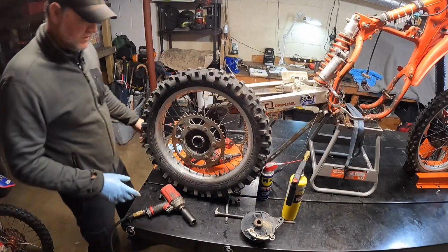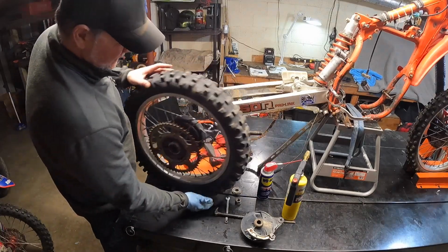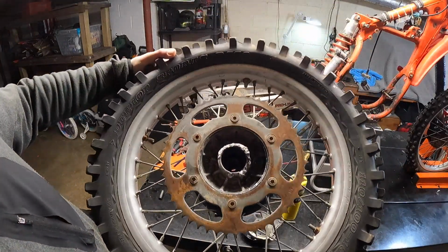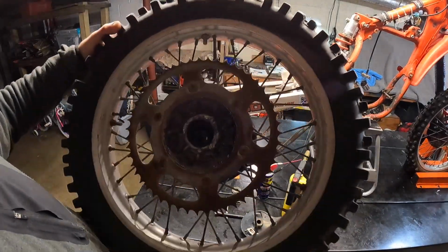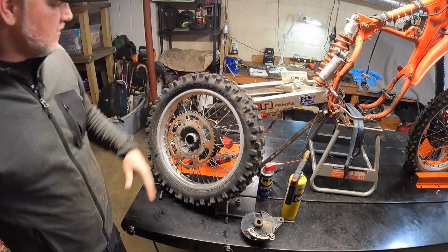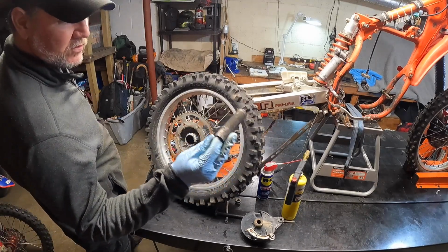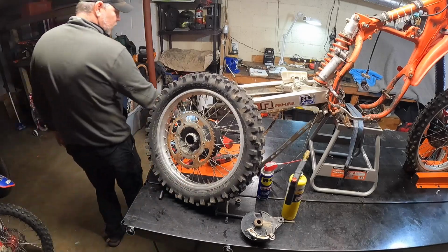So you guys saw how to use heat on that axle and everything, but here's the reason: the whole entire bearing just fell out. I don't know if you can see that, but somebody tried to aluminum weld this rear rim. Somebody messed that up pretty bad. So like I said, that's why I had ordered another one, like I said, I got off of eBay. That way, we don't run into any issues. We'll keep the inner sleeve. We'll clean the inner sleeve all up, see how it looks, just to see if we possibly need that on the other one.